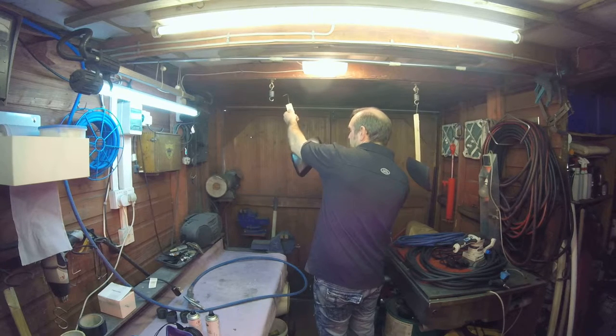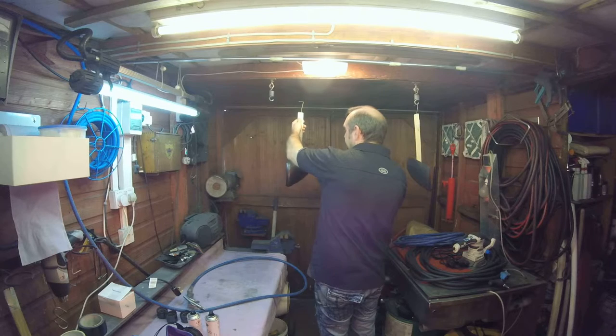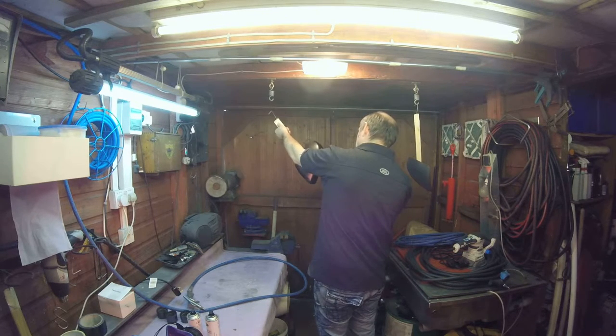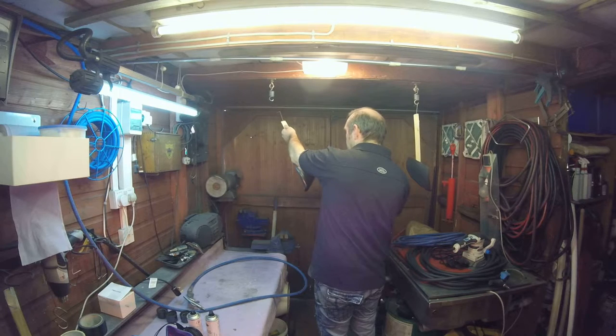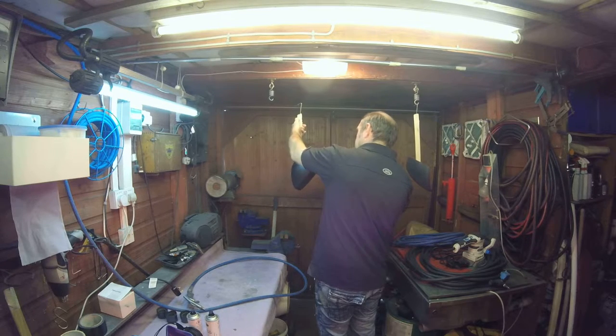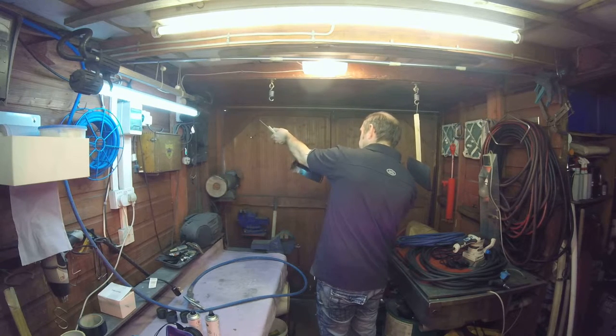Pan moving quite fast if we are putting on a metallic base coat. Lots of light coats, keep moving the part. Once you see that there's an even wetness to it, that's the first coat finished.